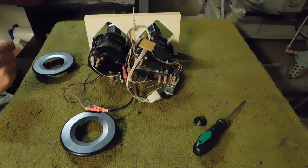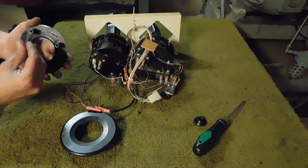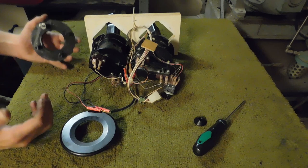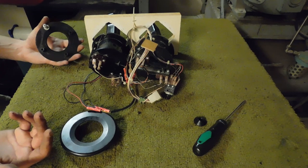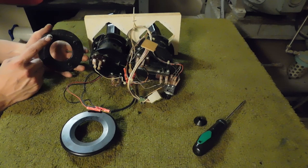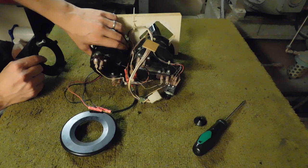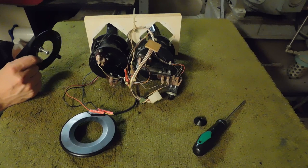we'll actually use a screw, like so, to go into the slots of the joysticks and thread into these little rings, okay? And that's how everything's held together. That's it. So, ultimately, it will hold because it's using a pressure technique, but you have to be careful because if you tighten these screws down too much into this plastic, you will most likely crack or break off these little studs, which will cause these joysticks to be loose and floppy. So we have to be careful about that and recognize how tight we're making it. We don't want to overdo it, we want to make it just right.